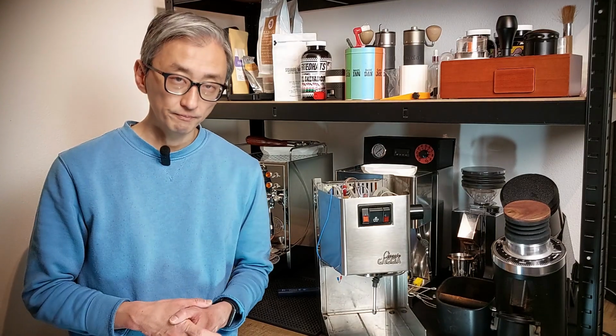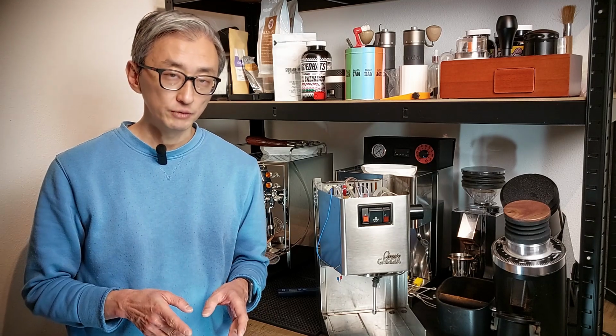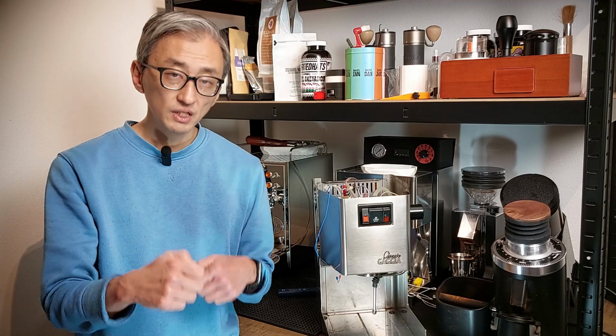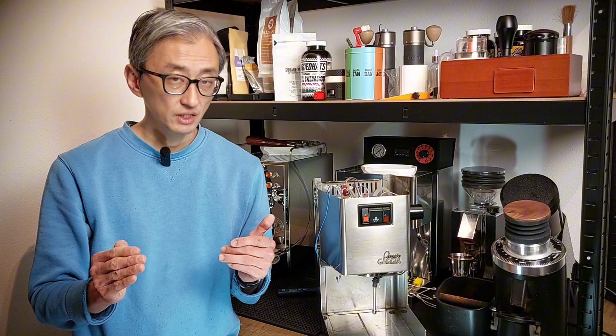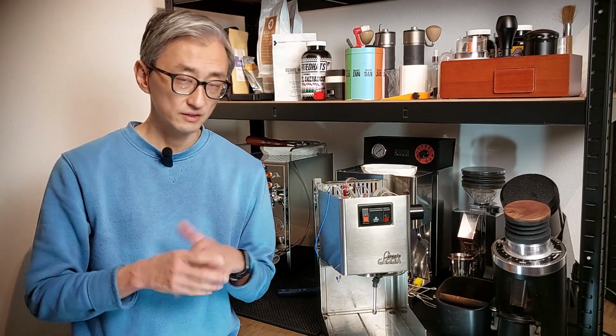And what I am doing, I use water between 90 and 110 ppm. Why 90 and 110? Well, because I don't need to be so precise and hit, for example, 100 ppm. I stay in this band, because when you mix the ZeroWater and the tap water, the measurement is going to be here and there. So to make my life a bit easier, since it's another routine in my maintenance already, I stay within this band that is easy to achieve.